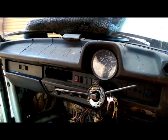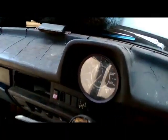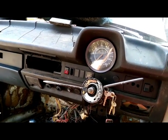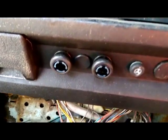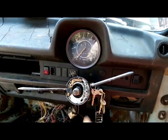The only difference will be if you have a car with original air conditioning fitted — there will be a few extra bits of duct work to remove. So all that actually holds these dashboards in are two screws down either side, a bracket in the middle, and a row of clips along the top under the defrost panel. But there are a few other things attached to the dashboard which will need removing to get it out — mainly the bonnet release cable, the ventilation cables, and various electrical stuff: headlight switch, hazard, fan switch, and speedo.